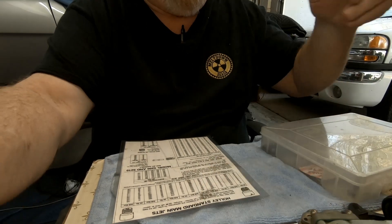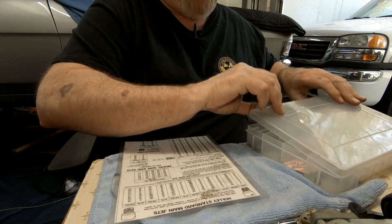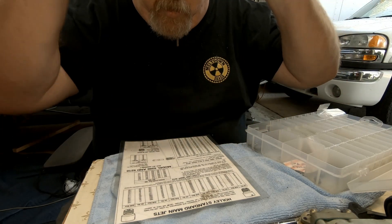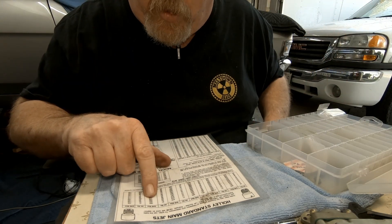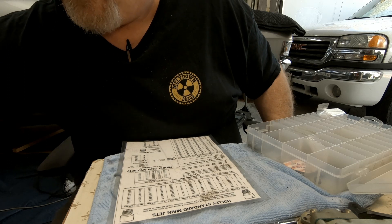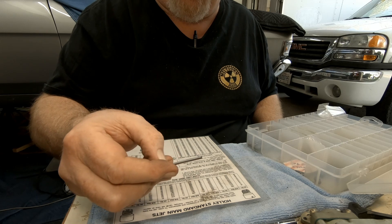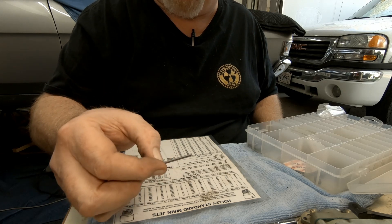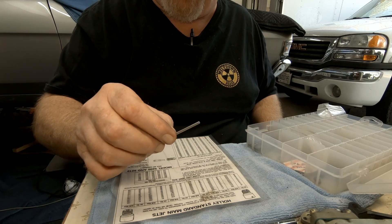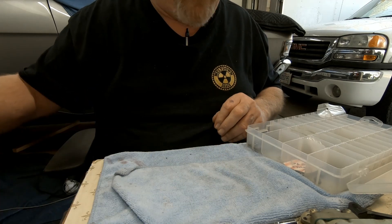What happened was, this carburetor had 84 jets in it, squared all the way around. According to our sheet here, an 84 jet is a .099 drill size. This is a .099 machined drill blank — very accurate. That's what Jimmy told me to buy, and he said start checking your jets. I thought, yeah okay, whatever, I'll give it a shot.